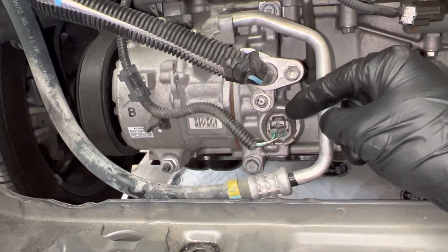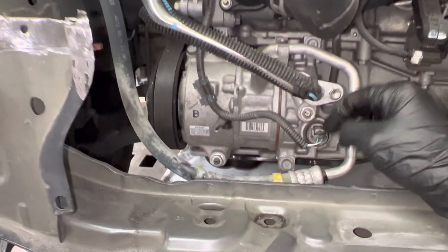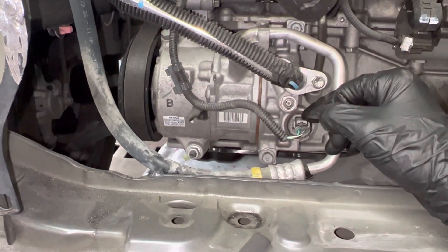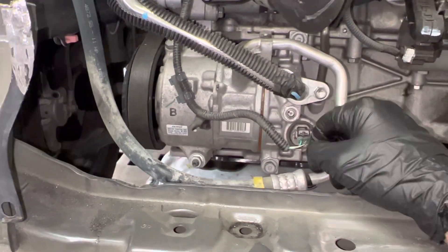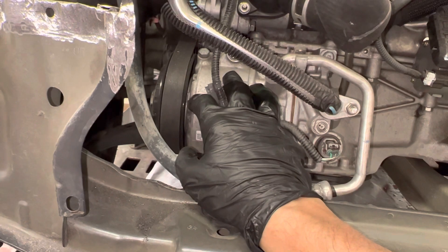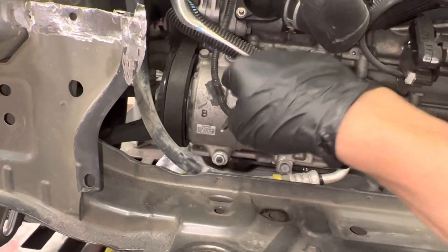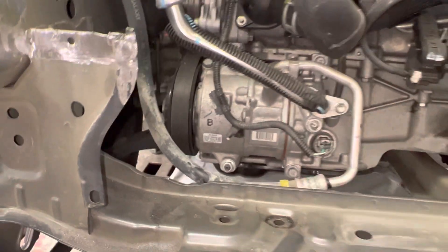You should be seeing these flooding into your shops — they're failing left and right. But it's only this little solenoid valve, unless somebody contaminated the system with moisture, air, bad refrigerant, improperly charged it, or used the wrong oil — then the compressor will go. If nobody messed it up, it's usually just a valve. It's usually the technicians who service the vehicle that cause the compressors to go out, unless some other exterior force caused it.